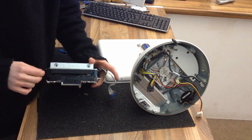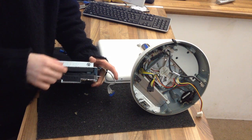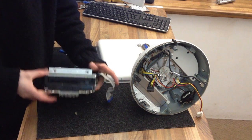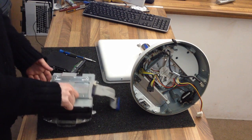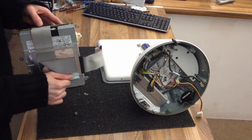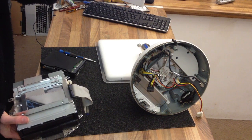All you need to do is remove the front bezel, leaving just the bare tray, and you can replace this with a standard drive, and it will fit in. Just remove that front plastic bezel. So you could replace it with a DVD burner or dual layer DVD drive. Again, I wouldn't bother, but if one was so inclined, you could. So put that out of the way and lick my hand as it's bleeding for some reason or other.